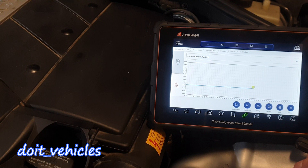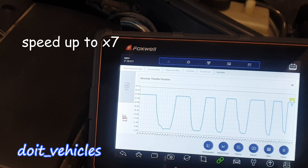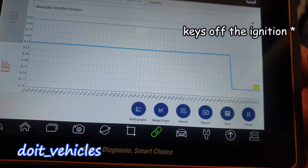It's especially difficult to detect just with a voltmeter, especially if you've got a very hard-to-access connector in there. Anyway, let's go and press on the acceleration pedal and you should see the spikes. It went up to around 27 degrees. The signal looks good.